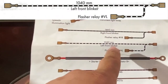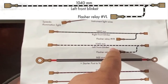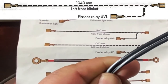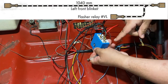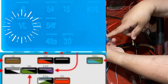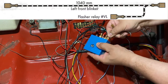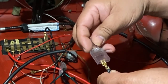After the black and green, the next wire is the black and white — same thing. This will be for the left-hand side, for your blinkers on the driver's side. These aren't striped like shown in the picture, but that's how they look. We're going to install this: the short part connects to VL on the flasher — VR is for the right and VL is for the left. You also have the same Y-connector here; it doesn't matter which side you put it in once connected.